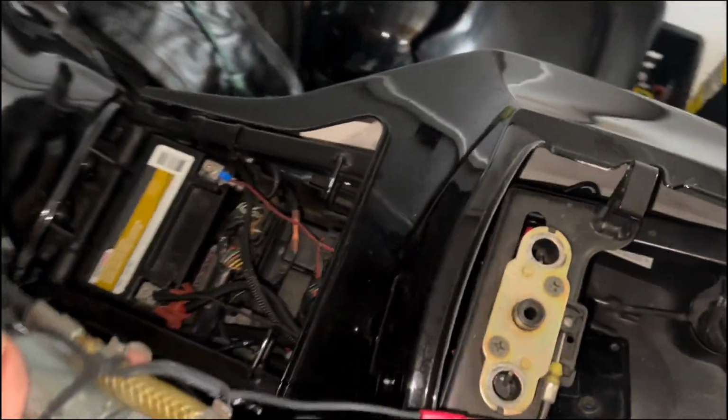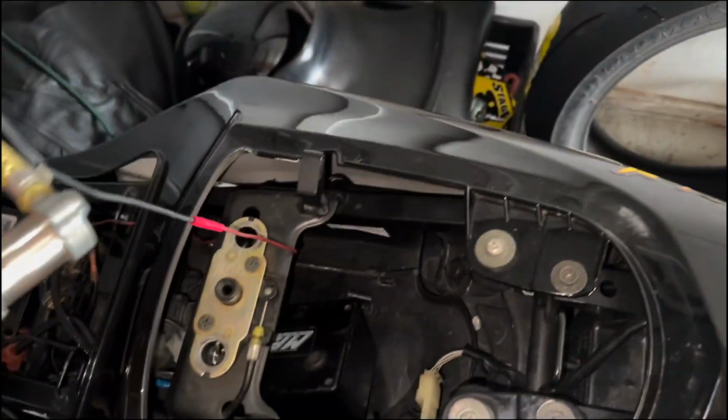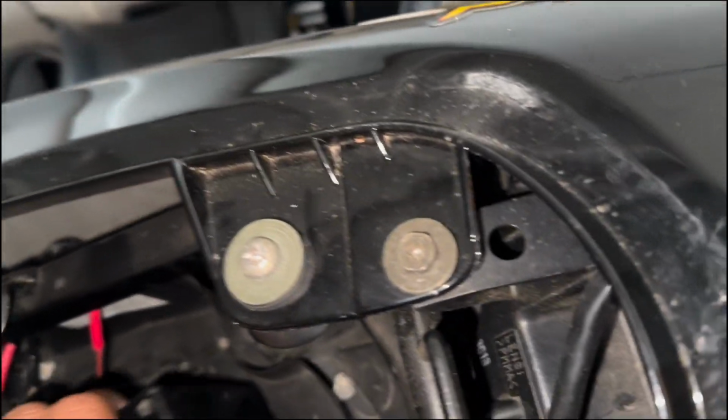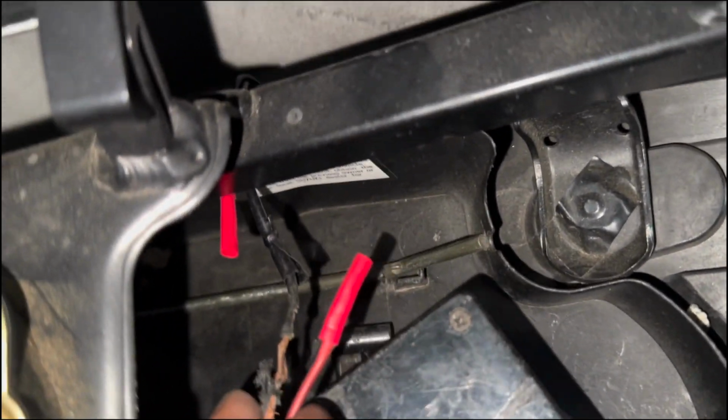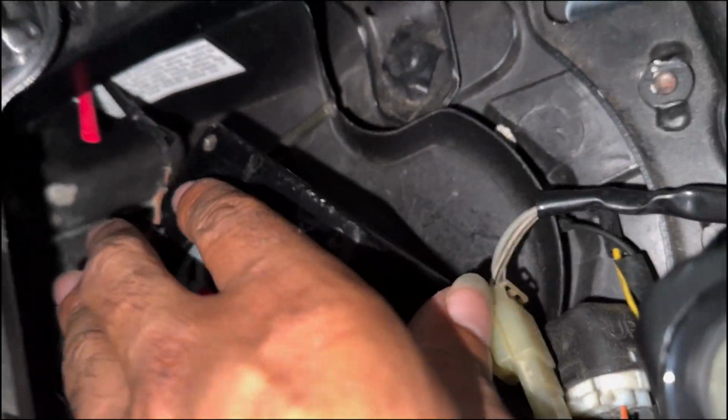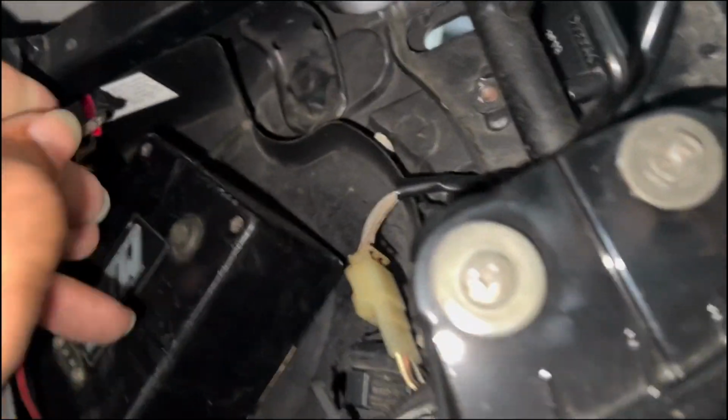But it turns out I might have ripped the wrong one out. Instead of ripping the ground wire for this out, I ripped the ground wire out for my actual air shifter. So looks like I'm gonna have to make a new connection. Let's see, here we go. That's where it started burning up. It started burning up in the switch? I guess it might have rubbed along it for a while, and it started touching metal and grounded it out. So I'll cut it right there and leave the switch, so that way I'll be able to add another one.